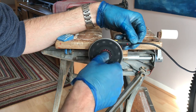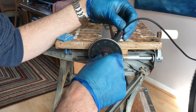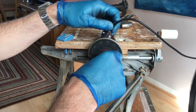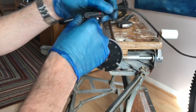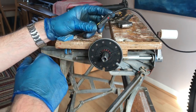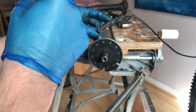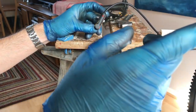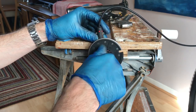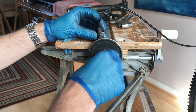It just needs a little bit of a twist and it works. So make sure you test before you glue anything in place — most angles will work, so your various tubes and mounting methods will be fine. But as this test showed, if you want the pedal assist to run in the opposite direction for the chain wheel side, it probably isn't just a matter of changing the computer setting — you likely need a different pedal assist sensor designed for that side of the bike. I hope this helps.